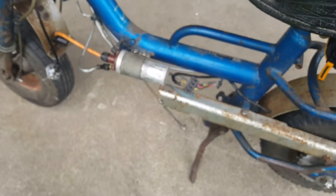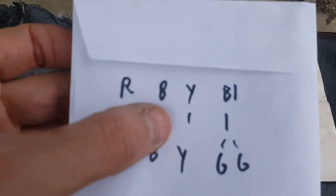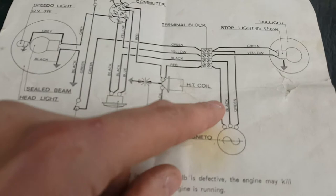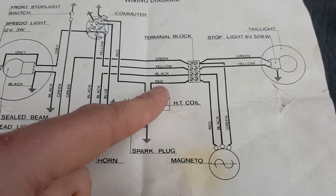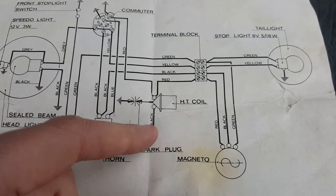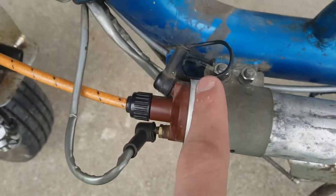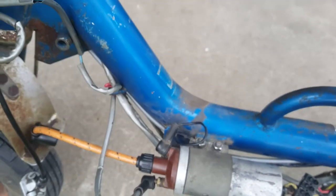When I get my motor back in maybe I'll film another video. Mine is yellow to yellow, black to black, red to red. You can see black off the magneto, red off the magneto goes to the coil — red goes through the coil, black just goes to ground. There's a black coming off the coil to ground and a red right there. That's pretty much the gist of it.